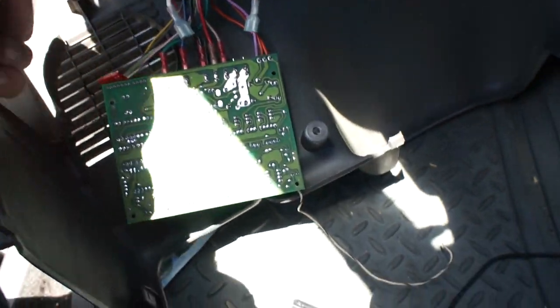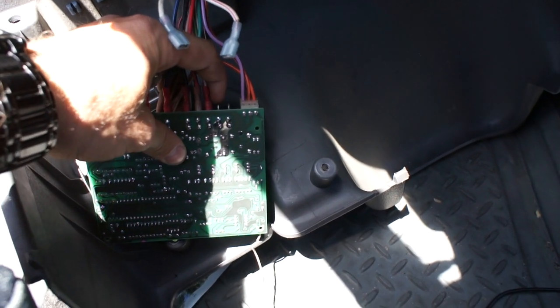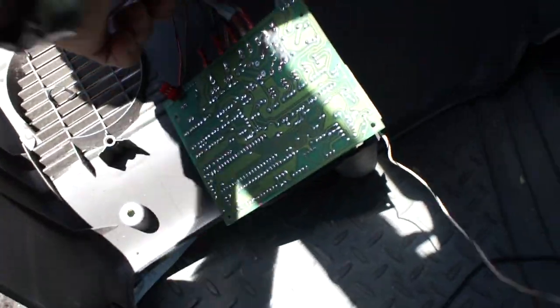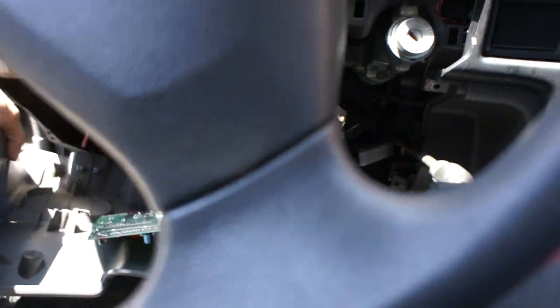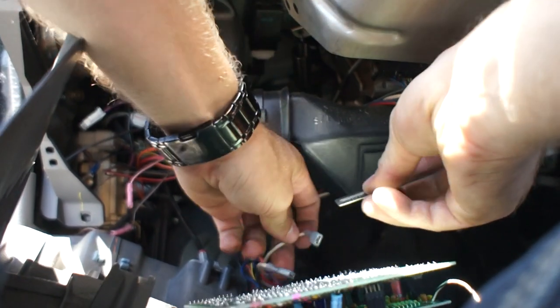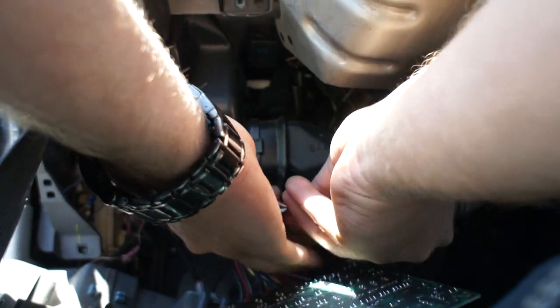This is the remains of the alarm. The starter white wire and starter motor red and white wire were plugged in here. On the other side of the board there's a large relay. It turns out that if you first get your foot on the clutch pedal, and then connect these two wires with a chunk of metal — such as a can opener — the truck will start.